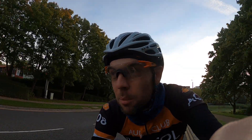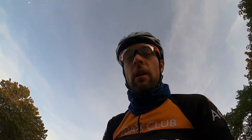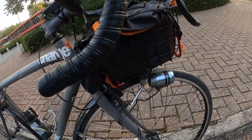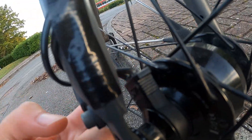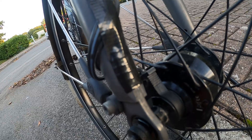Just putting the Sine Wave Revolution back on this bike — quick video. So it's a wider off my hub. I've got an SP dynamo hub here. It's been two years I've been using this thing. That's the hub, that's the plug. I've wrapped the wires for the Sine Wave Revolution in there, heat shrunk them together a little bit, and they're in this plug. This plug has got two bullet connectors so I can take the Revolution off if I want to.